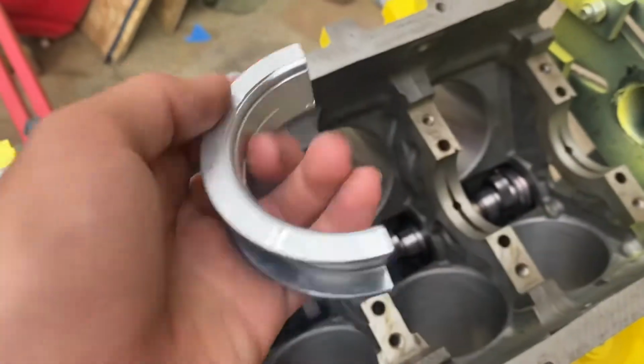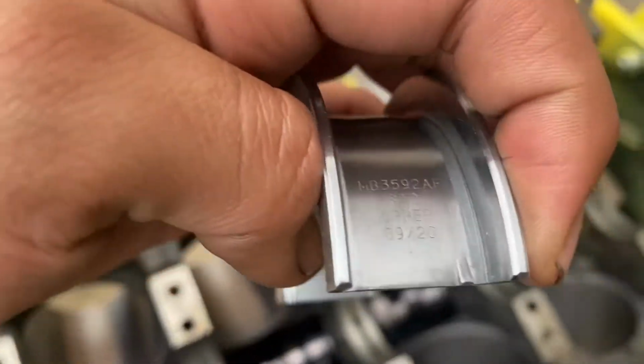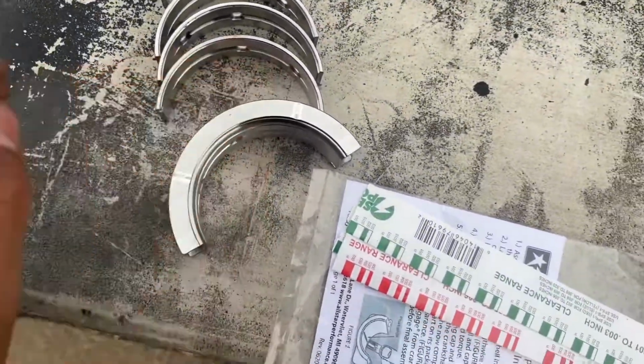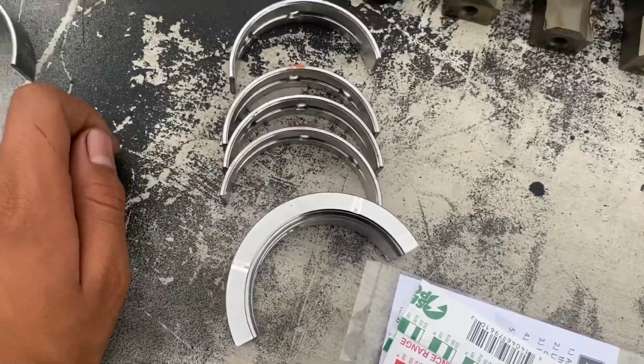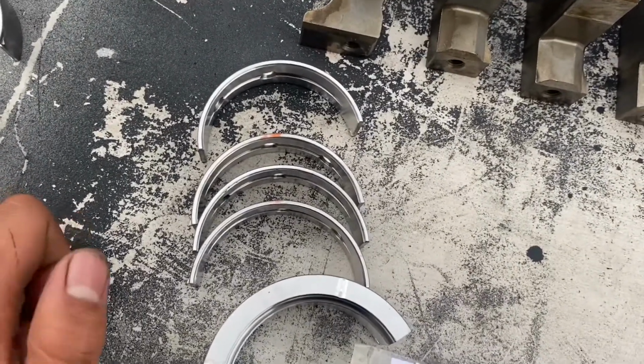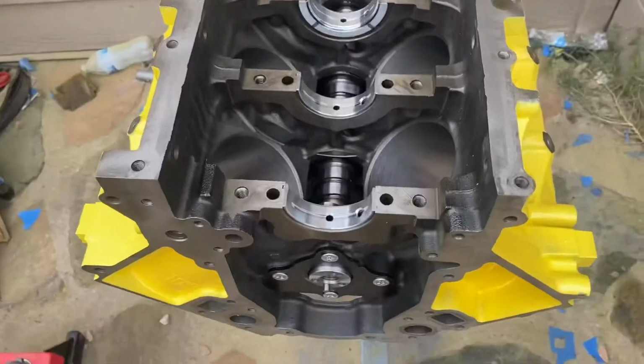Here it is. Obviously, should say upper. There you go. And then STD for standard size. I'll leave the part number for the bearings that we used in the description. But yeah, I'm gonna go ahead and put these in. You want to put them in dry, no lube, anything. Make sure everything's clean and there's no lint anywhere. All right, there you go.